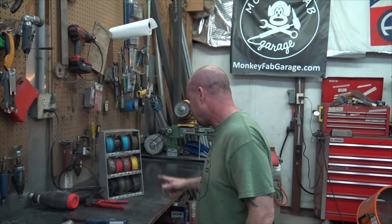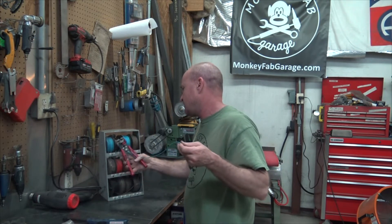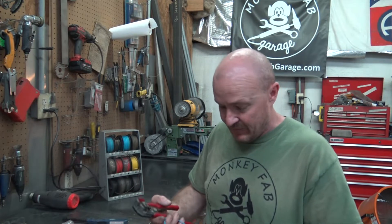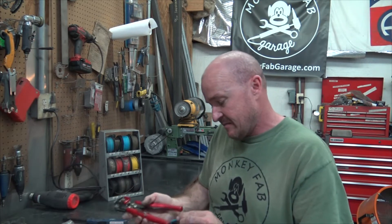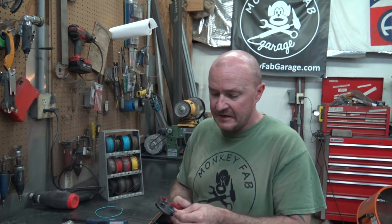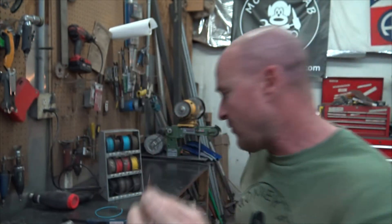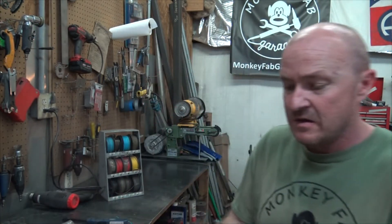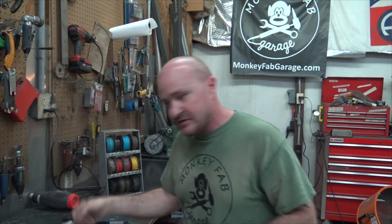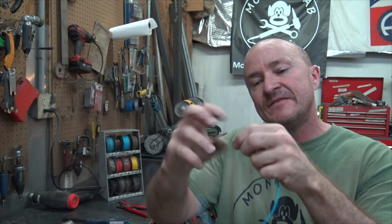I have this crappy eBay wire kit I've had for a decade — we're just going to use some 18 gauge wire. If you don't have wire strippers like these, you should figure out where to get them. I've had these for decades — I bought them from Radio Shack back around 2000 and they're awesome. I don't go shallow; I actually get in there and grab a chunk, then as I pull it off I give it a twist, which wraps it all around itself. And remember to put the shrink wrap connector onto your wire before you start getting it all tucked up and put together.